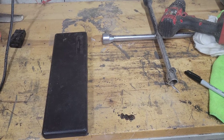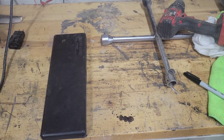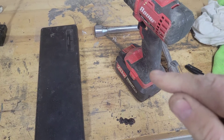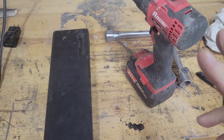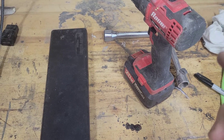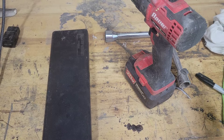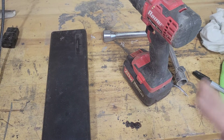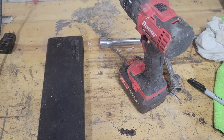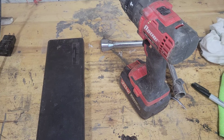Take your time, there's no hurry — you're not trying to win a race. If you need to do any adjustments, you can use a drill on those little ribs or that little button to take some weight off to even them out. Take a little tiny bit off at a time, re-weigh them, check them until they're all even. If you cut the skirts all the same, I've talked to several guys and the weight comes out exactly the same. I'll talk to you later in the next video — thanks for watching.